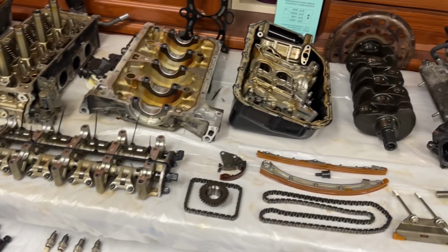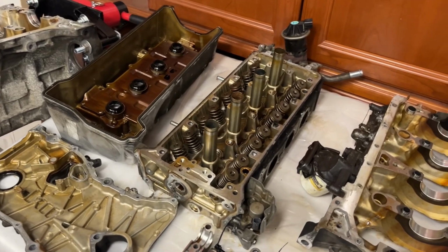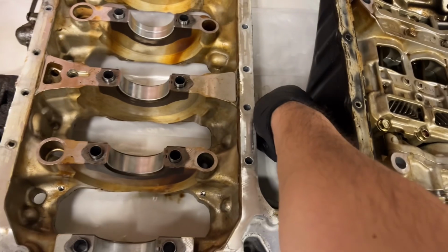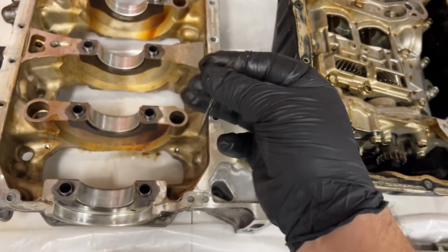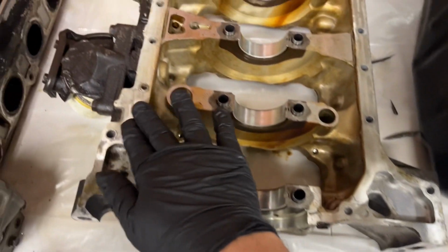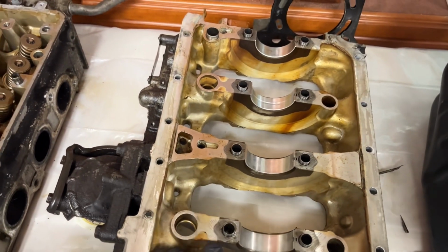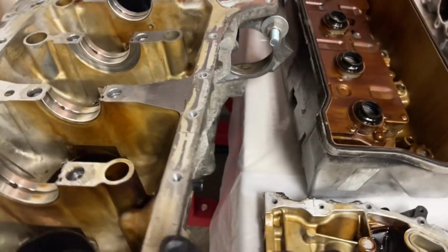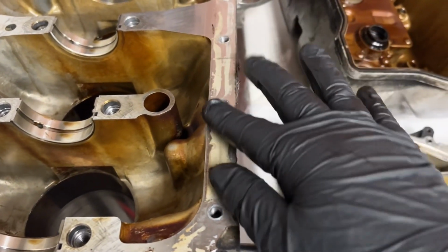So as I mentioned before, this car overheated for a long time, and finally the seals failed. It's so brittle. Look, it's falling apart. It's not rubber anymore. This is very, very soft. I didn't scrape any of these, and look, it almost looks clean. So all these seals burned, and that's why the water went into the oil side.